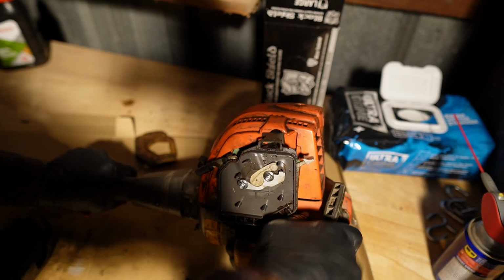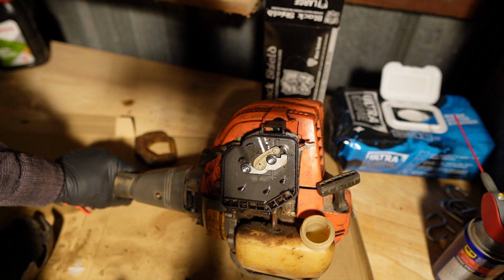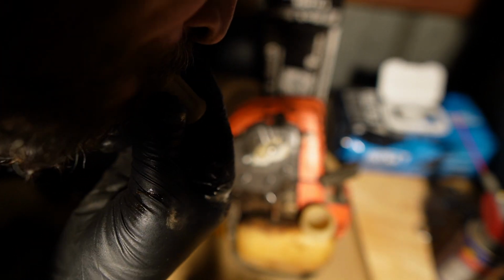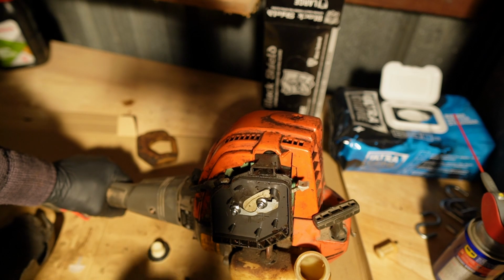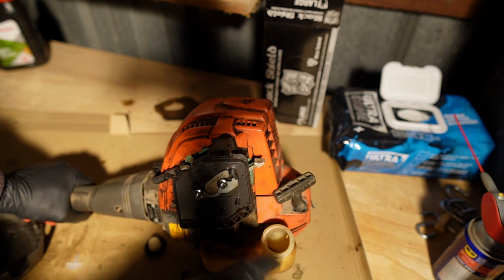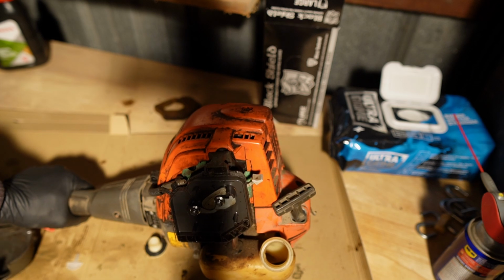Now let's move on to the fuel tank. Now he said he'd emptied it, which he did because there's nothing in there, and I actually took a look when he was showing me this first things first. I reached down in there because it's awkward to do. I didn't want to do it on camera. And I pulled out the fuel filter, which looks like this. Because it was dry, I even gave it a little blow to see if stuff could pass through there, and it's decent, but if I'm going to go to the trouble of trying to get this thing running, I think I'm going to get a new fuel filter, and the cost of something like this, the little air filter and a fuel filter, is pretty minimal. And if you're wondering how to get that out of there, basically you need to get something long and fish it out of there. If you have a set of really long needle nose pliers, that can get it out, but not always.